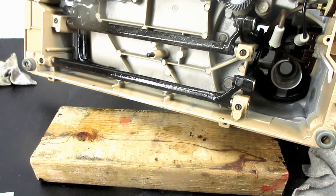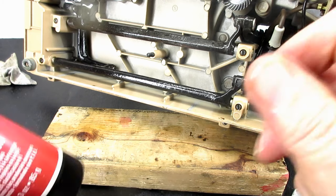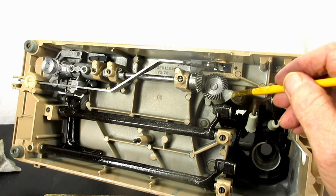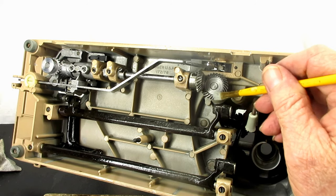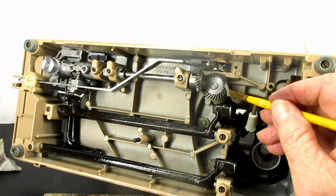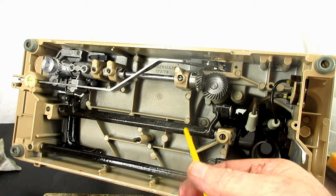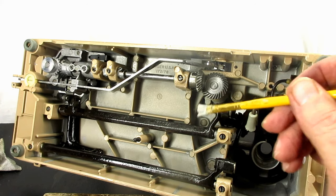You'll see this grease stick up off of the gears like that. When I first run it, I run it slow so that the grease will melt a little and get in between the teeth. You don't put fresh grease on and then run it full blast. Even though this grease clings better than a lot of other ones that I've tried, if you just put on fresh grease like this and slam the foot pedal, it's just going to toss a lot of it off onto the other parts, which is just going to collect dirt and gunk,